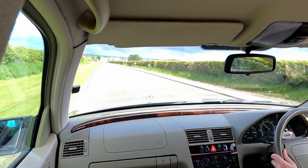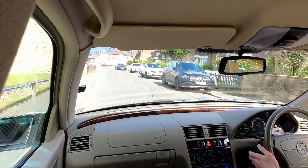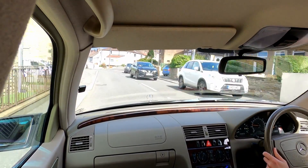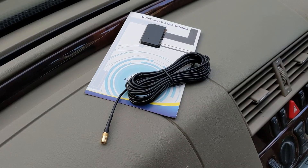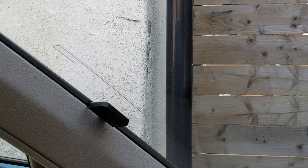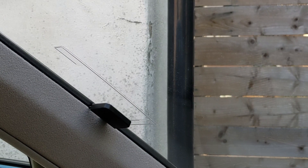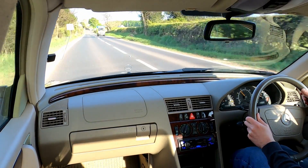The Celsus AN3012 DAB glass mount antenna performs well, is easy to install, and doesn't take up much space on the windscreen. Using 12V phantom power from the DAB car stereo and the common SMB connector is also beneficial, as this avoids needing a separate power lead and converting the type of connector. To see more about the antenna and to buy directly from the Celsus website, please see the links in the description below.